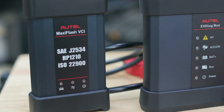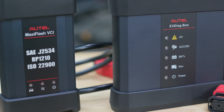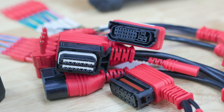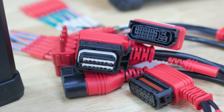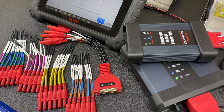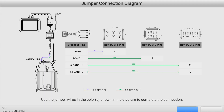One of the standout features of the MS-909 EV is its ability to connect directly to the battery management system independent of the vehicle and perform testing through the new EV Diag Box. The kit currently comes with several direct plug-in connections. However, for vehicles that still are lacking the specialized plugs, several pin-out leads are supplied and the tool will guide the service technician in making the appropriate connections right on the tool.